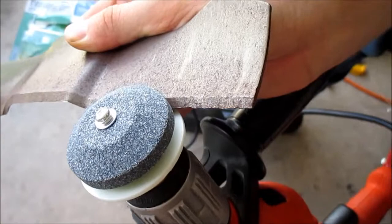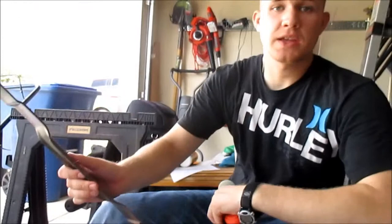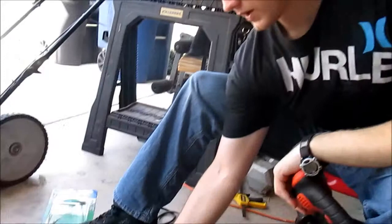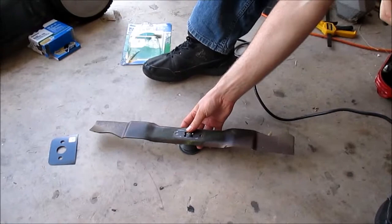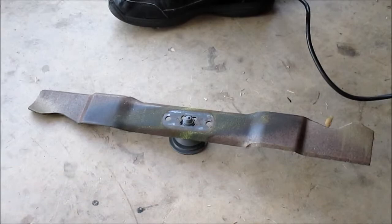That's how you sharpen that portion. But if you sharpen it too much and take off too much material on one side, then it's not going to balance in your lawnmower. That can cause skipping and other balance issues, and it can also make it hit other items inside. So after you're done grinding, take it back down to your balance plate, find the stage that matches yours, and put it on there. If it doesn't balance, it needs a little bit more grinding on one side.